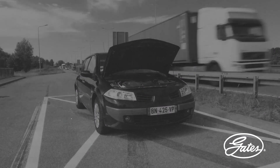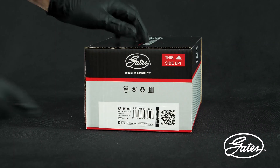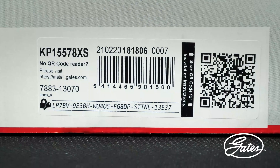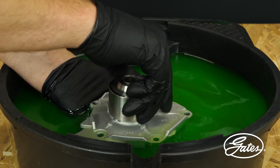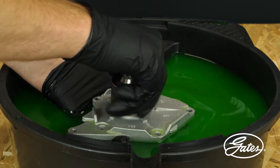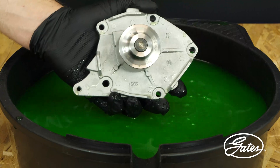This will result in constant coolant leakage from the water pump. Scan the QR code, which will redirect you to the assembly instructions and technical tips specific to your kit. If you want to rotate the water pump before installation, it is necessary to immerse the pump in coolant and run it about 10 times to form a mechanical seal, which acts as a lubricant and protective film between the dynamic and static seals, similar to the film created by oil between the cylinder wall and the piston rings.